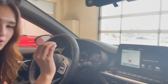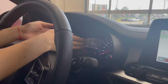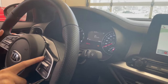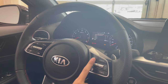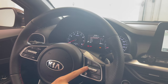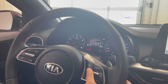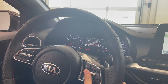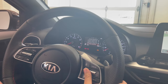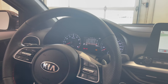So if your vehicle is equipped with the 8-inch touchscreen, your driver assistance settings will not be in your screen here. They're going to be located in your cluster right out front there. To control those settings, you're going to press this almost notepad-ish button and cycle through to driver assistance, then use the arrows to select. Go down until you see rear cross traffic collision avoidance or warning. In this vehicle it's only equipped with the warning, but you just want to make sure it's on.